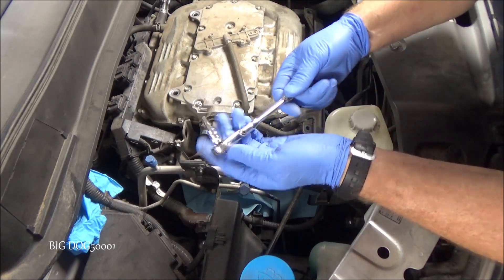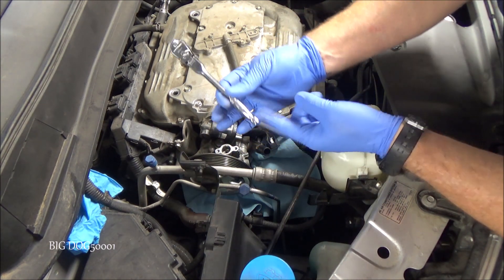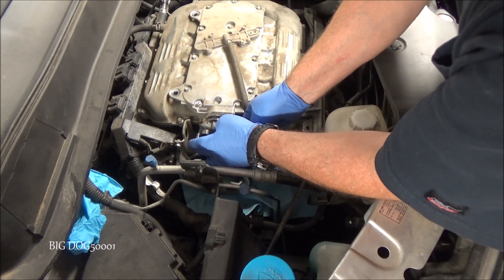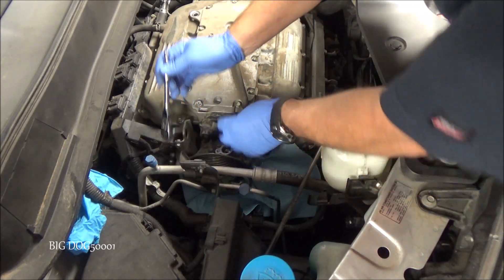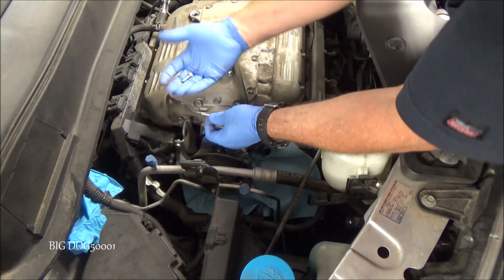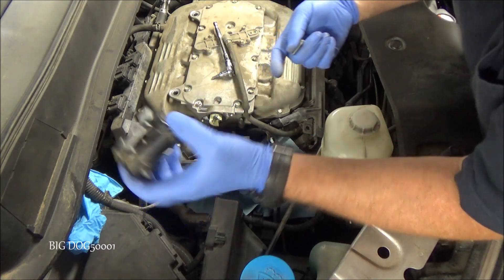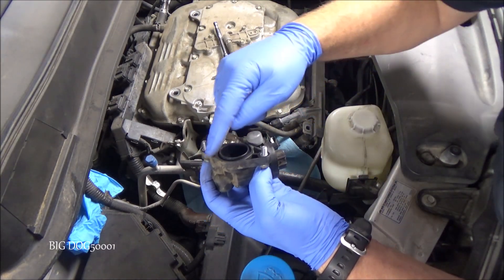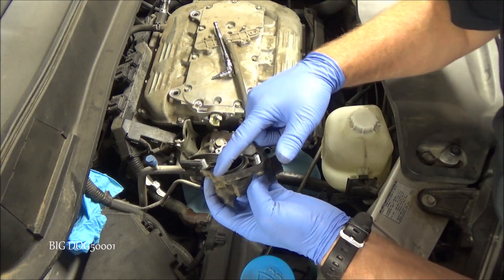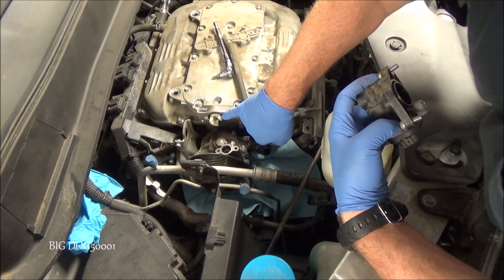If it's all the way closed, you get more low-end torque; if it's all the way open, you get more high-end torque. So let's go ahead and unplug this and pop these two bolts out. To pop them out we're going to need a hex — I'm using a quarter inch so it'll fit in here, and a five millimeter. They're not on there very tight. Now I can just spin them off and remove it. Now while I'm thinking of it, there is a gasket that seals this to the intake manifold. Honda recommends that you replace it, and we do have a new one for this job.